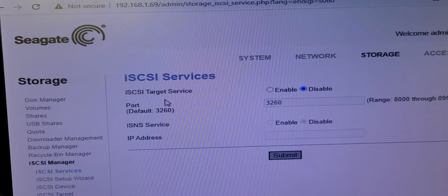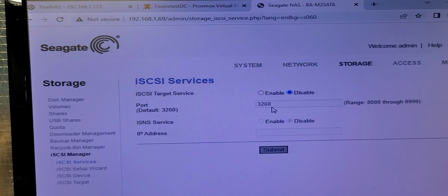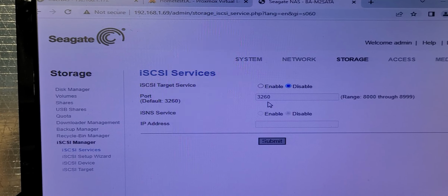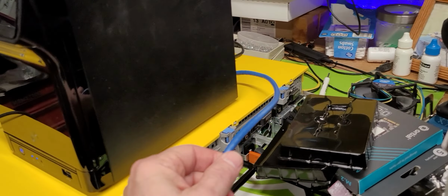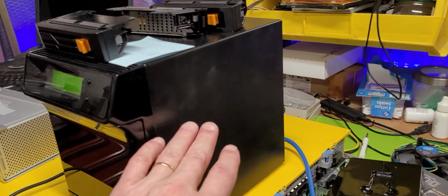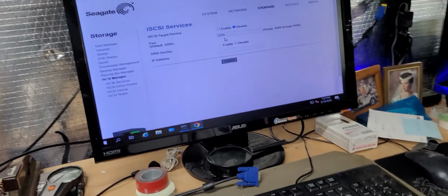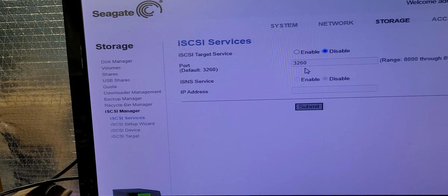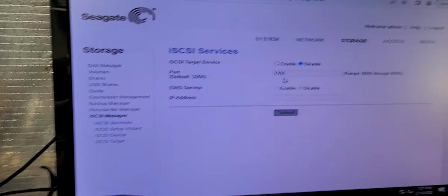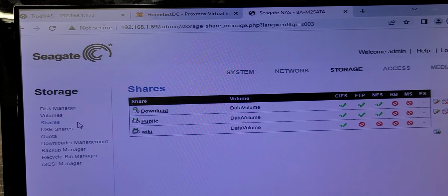Instead, you can use iSCSI, and you can create a single pathway iSCSI configuration. And what I said by single pathway is, in this environment, we're not using both NICs. We're only using one network cable. And that would require 2 network switches from this device with 2 network cables going through those 2 network switches to the actual server that has its own 2 physical connections. And you would treat that as a storage network that has no connectivity to the outside world. And that could act as an alternative to the aging share capacity you could have out there. Or you can just do NFS.